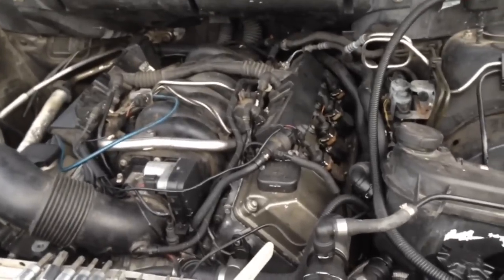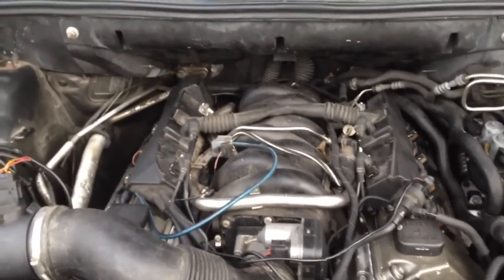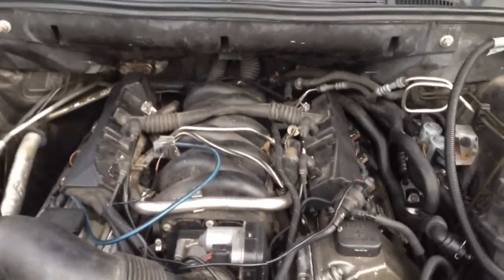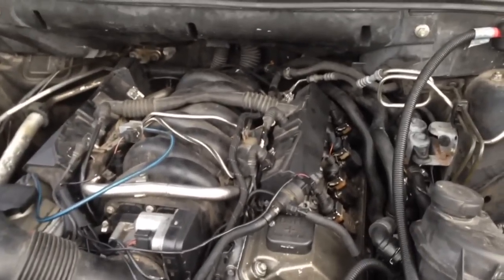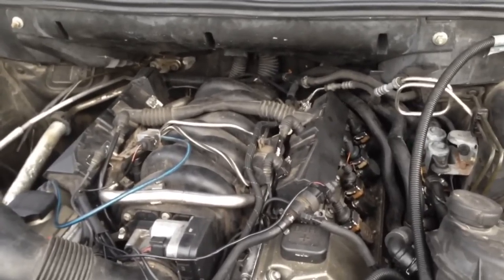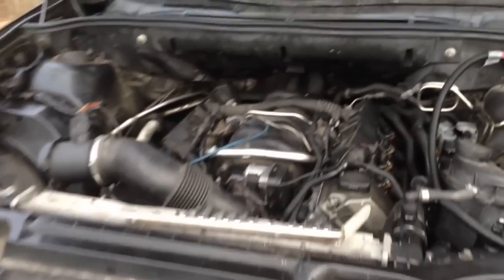We did get the Silverado done today. We took the passenger side apart and did the wheel bearing, ball joints, control arms, and tie rods. The tie rods were seized on, the brake disc was seized to the wheel bearing, and the wheel bearing was seized to the spindle. That took about six hours per side just because it was so rusty — when it's not rusty it's about two hours per side. On older Chevy stuff, you never know what you're going to get into — everything's going to be rusty.